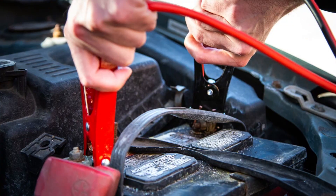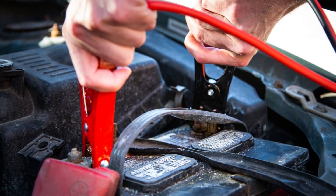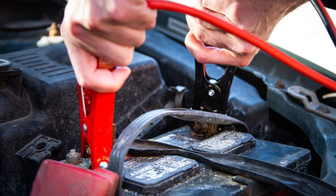For example, when the car is off, the voltage should not be lower than 12.4 volts. When the engine is being cranked, it shouldn't drop lower than 11 volts. And once the engine is started, the voltage should gradually go over 14 volts. A low battery and dropping voltage may trigger almost all kinds of messages and warnings since they affect communication with various control modules in your car. Charging the battery or replacing it with a new one may eventually fix the problem.